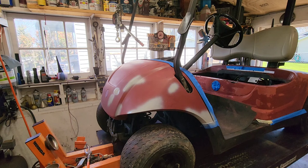Okay, I've got really good ventilation. I'm just gonna use a dust mask today. Not have my shaded glasses on today. Okay. All right, my working pressure at the gun is less than 10 PSI. I got 130 pounds of shop air coming to my little working gauge here, so I can regulate right up at my gun. I can change it as I go if I need to.